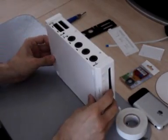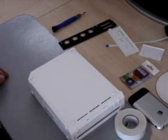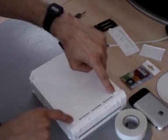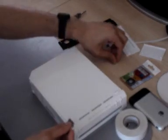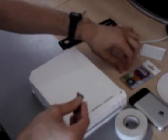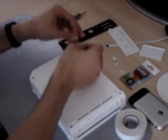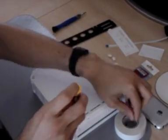Lay the console top-down. This is where the scalpel comes in handy. There are four tri-wing screws you need to remove — two are under rubber stoppers and two are under little labels. You just pick them out like that and you can do it without any visible damage to the Wii. Remove these four screws.